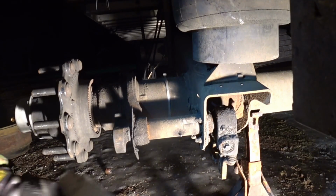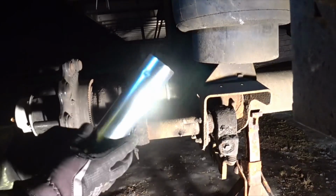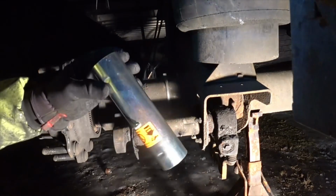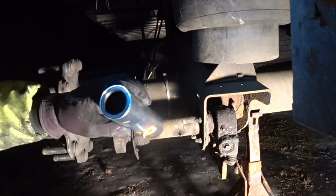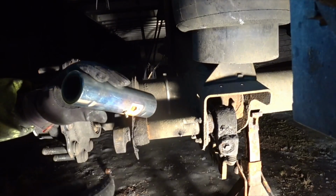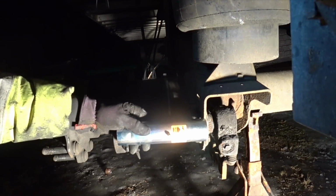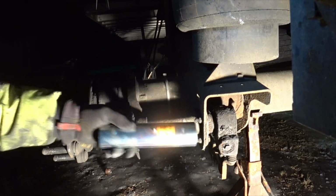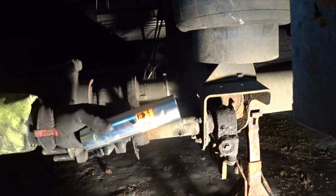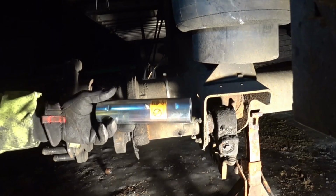Basically I thought it would be kind of a cheap thing because I looked at it, and it's like an alloy metal tube or whatever, and it already has the seals pressed in it, and all the bushings are already installed in here. There's one on each end, has your greaser on there, and it's a new tube that just gets pressed in there. I thought it was kind of flimsy, but I tell you what, I've been doing the other ones, and I think these things are awesome.